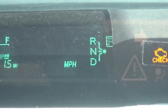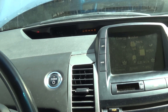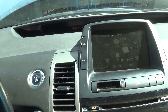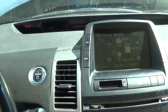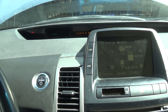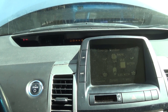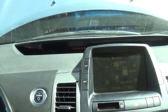There's no zero, no ready light. If you listen, in the back you can hear a clicking, which I believe is the 12-volt battery trying to activate the hybrid battery to take over the system. Once the hybrid battery is activated by the 12-volt battery, the 12-volt is then charged up to around 13.6 to 14 volts through the DC-DC converter, which takes the 200-some volts from the hybrid battery and steps it back down to a usable 13.5 to 14 volts.